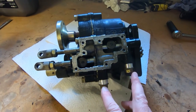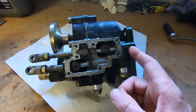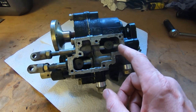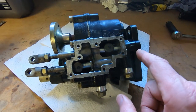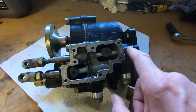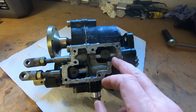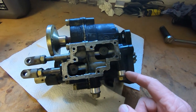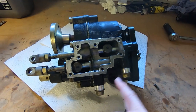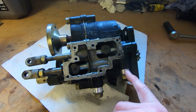The way this works: you've got gears in the bottom of the box and two selector forks — one for the two forward gears and one for reverse. It also had a habit of locking up solid so nothing would turn, which is usually a sign it's going into forward and reverse at the same time. There are two cup bolts with a big spring and ball bearing used as indexers for the two rods. Turned out somebody had it apart before — the ball that should be sitting in the tube had dropped into the space at the end of the rod, preventing the rod from moving all the way across. I cleaned it all up but it was still very tight.